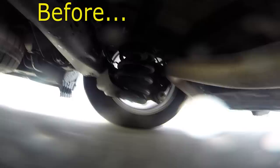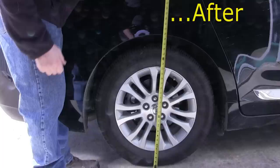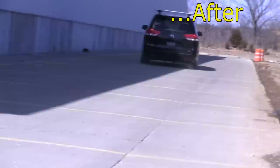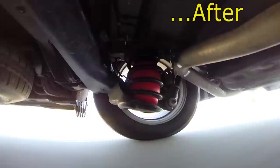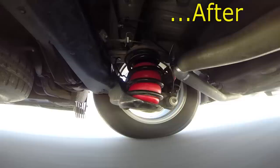Now we'll go ahead and install the Air Lift system. With our Air Lift system installed and our 765 pounds of weight in the vehicle, airing it up brings our new ride height to 28 inches. As we go back through the slalom course with the Air Lift system installed, it really helps control the body roll and sway, while bringing back our steering response. As we go over the bumps, it controls it much better and it's not as shocking with the excessive weight.